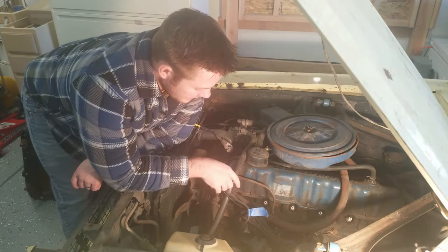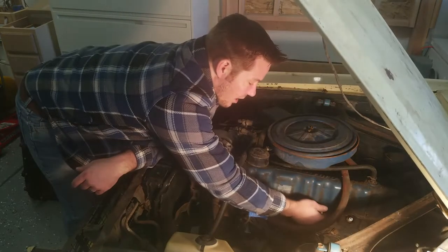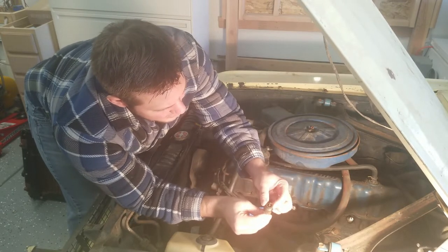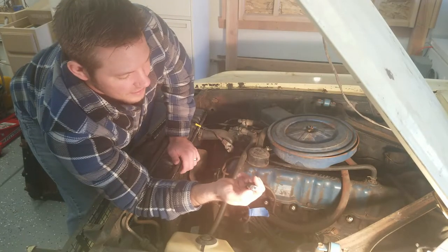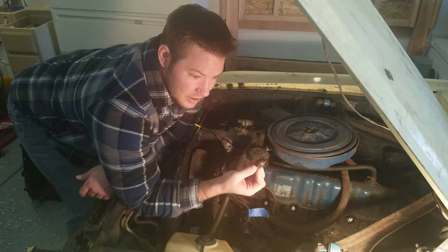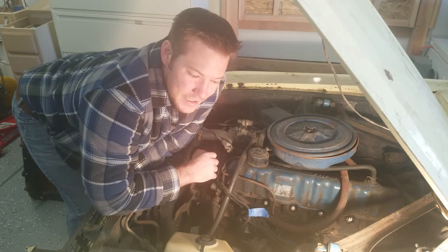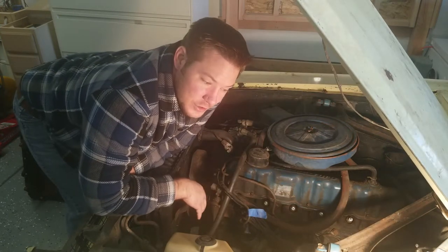If your car has been sitting for a significant amount of time, you're going to want to put a little bit of lubricant onto these spark plugs before removing them. I'll pull one out here — it's pretty crusty and pretty rusty. The last thing you want is to be busting off the ends of your spark plugs, because that's what conducts your charge. Regrettably, I got a little impatient and fat-fingered — I busted off two of them. Whoops. Fortunately, I have replacements for those.